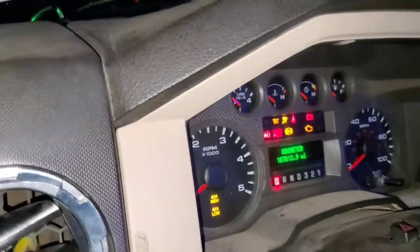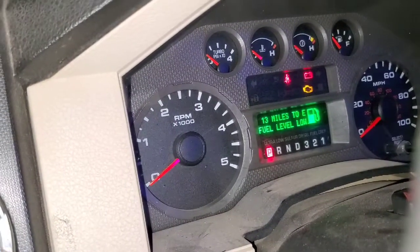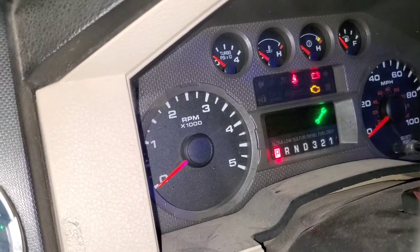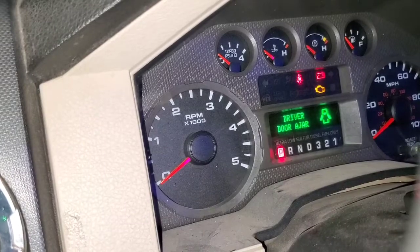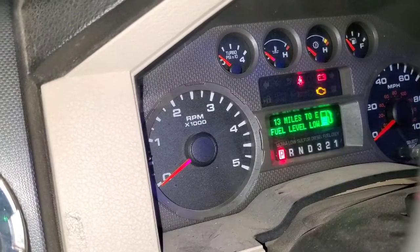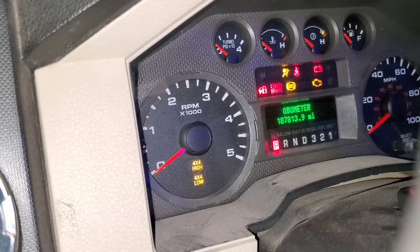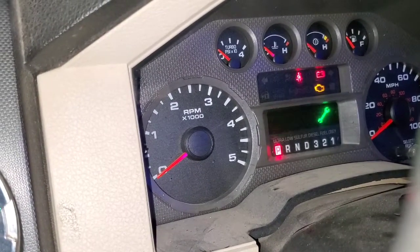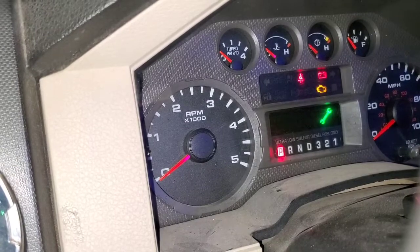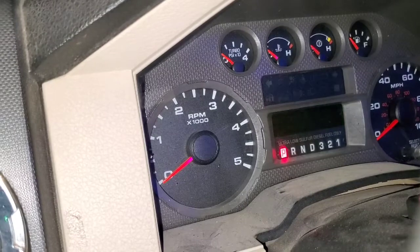See if she fires. We're still going to cycle the key all the way on — do that 30 seconds, do it a couple times. That wrench light is low injector control pressure. Obviously if you don't have good fuel pressure, you're going to get that. Still not much on the gauge — I don't know how much fuel he put in. I added about three or four gallons, so we'll get it fired and take it out to get some fuel.